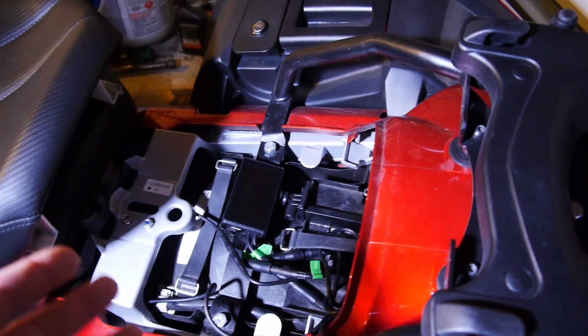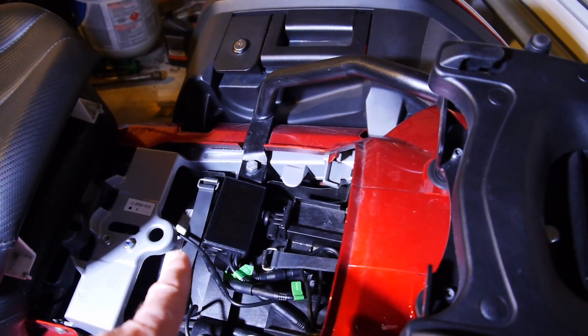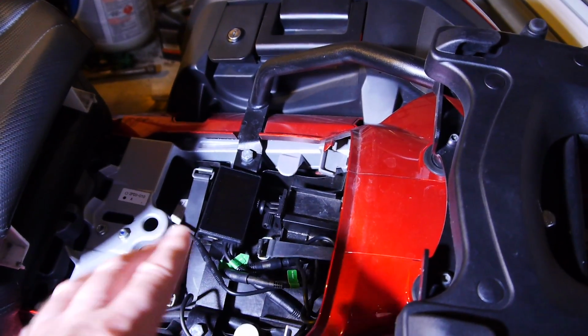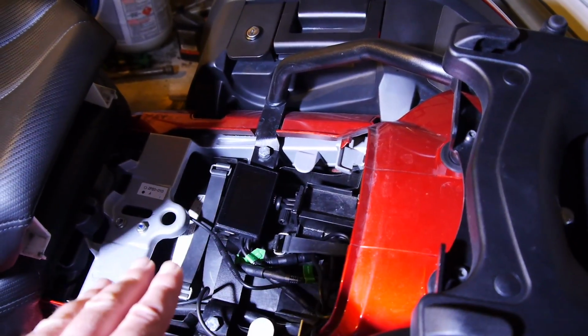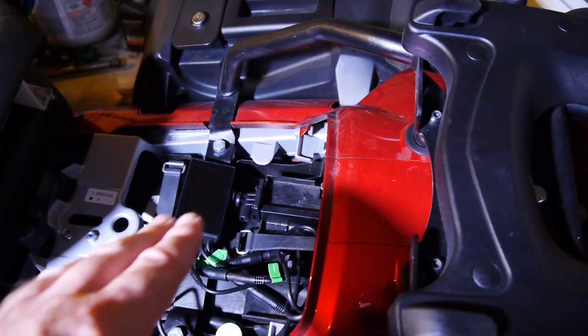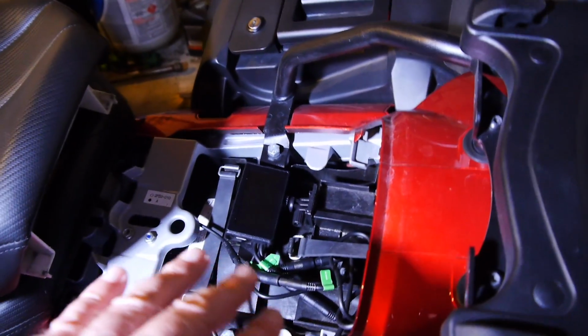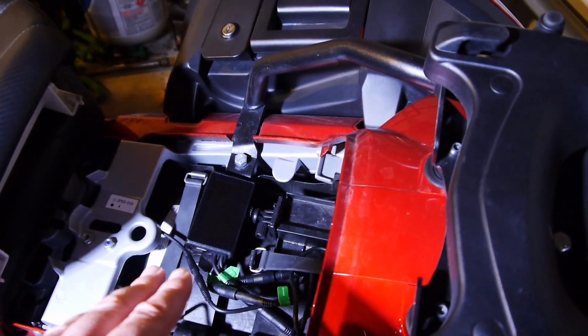So how is it protecting you? Well, the G sensor here is constantly monitoring. And don't forget, there is a low voltage protection in there. So at 12.1 volts, it shuts itself off completely and is not even monitoring for shocks to save your battery. But if your battery's good, I don't know how long it's going to last before it gets down to that point. That's going to depend on your conditions and your battery conditions and how much draw this has.